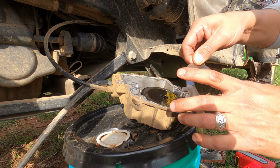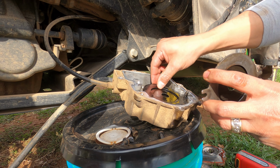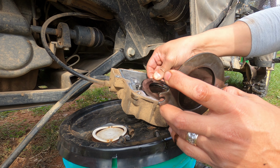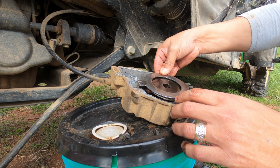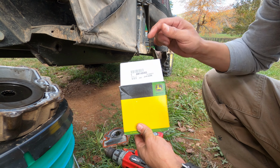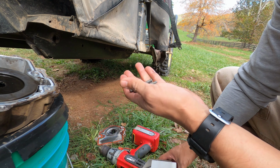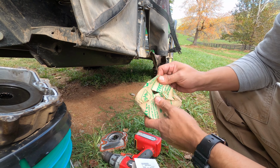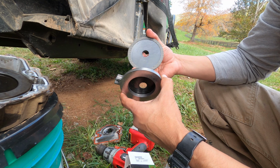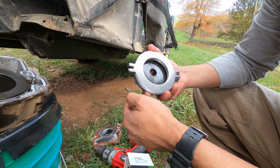So you had this one on the outside, and then you have these that go in, and it's just a sequence of back and forth. So I have the part, I'll go get that and we'll change them out. For this type of Gator, there's the part number just to replace that part right there. It comes with 2, I guess, set screws, and then these are the new bushings or plates that need to go in there in between. So we'll go ahead and sequence them right now.